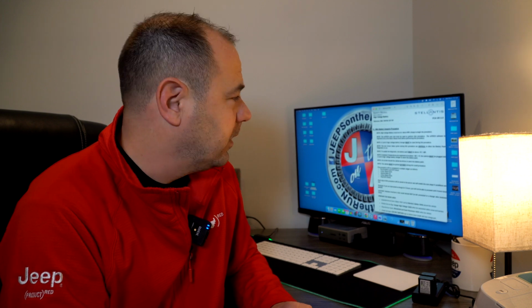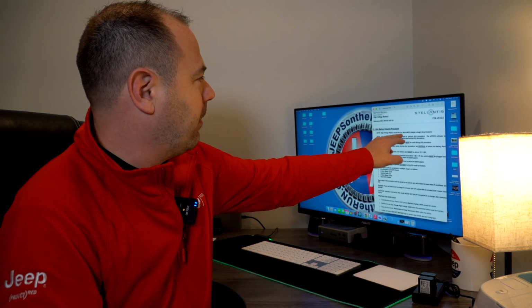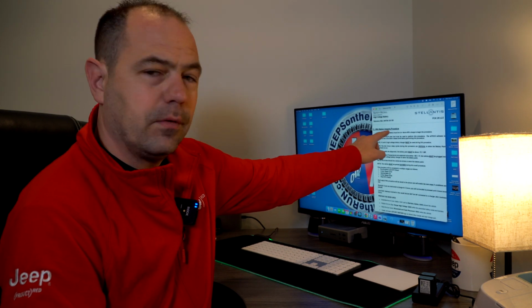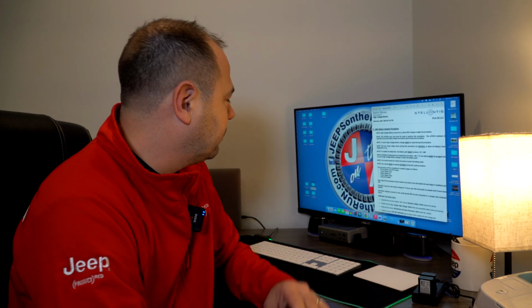If you haven't been charging your Jeep, or even if you have, by the time you get to your Jeep dealership, it's likely going to be under 90%, unless you did it on eSave. So let's just assume you get to the Jeep dealership and it's under 90%. Step one, high voltage battery must be above 90% to begin procedure. This is the battery integrity procedure. It has to be charged at level 2. So let's say it's at even 50%. You're still about an hour of just charge time before they can even look at your vehicle, right? Give or take. If your battery's dead, you've got about 2 hours, maybe even a little more than 2 hours of just charge time before they can start the procedure. So let's call it 2 hours worst case.